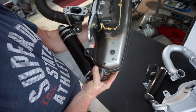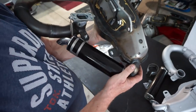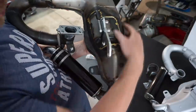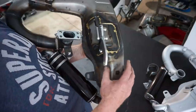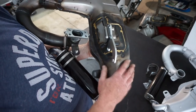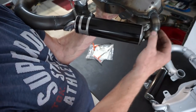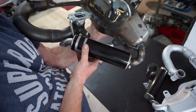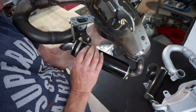We've now got the V4 Sport. This one has had modified baffles inside — they've changed the baffling to create more power. This one has, I think, more power than the V3 originally had. But when you change the baffling, the exhaust gets noisier. So what they've done is they've put this muffler on that fits underneath, so you can't see it. It's then bracketed up onto the downpipe here, and this reduces the noise.